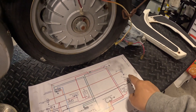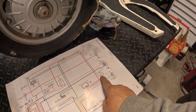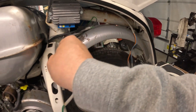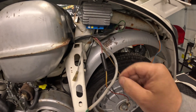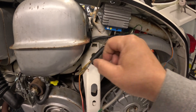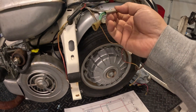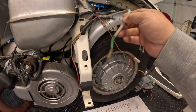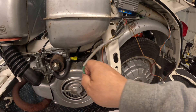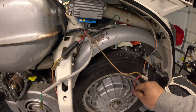After that I should be able to kill the bike with that switch up on the handlebars. This gray wire here actually went to the turn signal flasher. Since we got rid of the turn signals, we don't have to worry about those or this. So right now we have the red wire eliminated and the gray wire eliminated. These two green wires — this pair — actually went to the HT coil. We don't have an HT coil anymore so we don't have to worry about that, but just leave it hooked up and tape the end because it's still live.